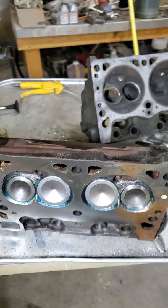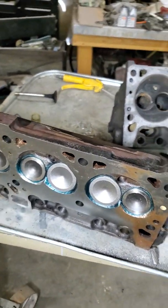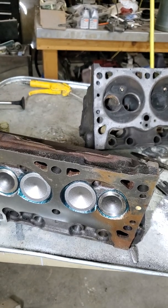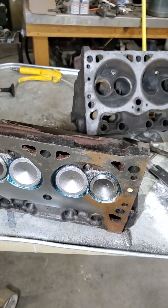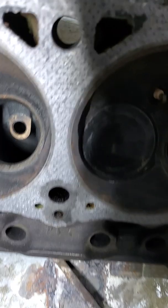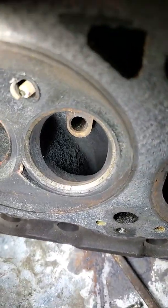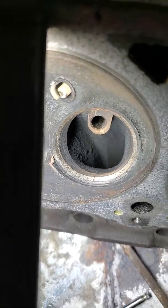All that needed opened up, because the valve did nothing — which meant it wasn't the restriction. And I already had the intake hogged out too much on the pushrod pinch, so that meant that wasn't the restriction either. The valve wasn't the restriction. Again, it's the bowl — it's the short turn down in here. Widening that and blending it — that's what it needs.